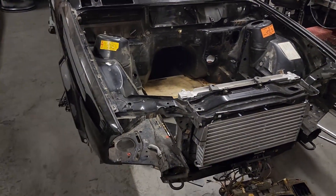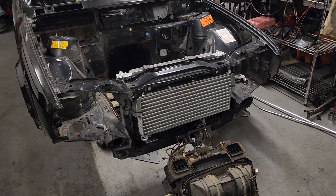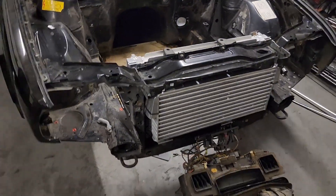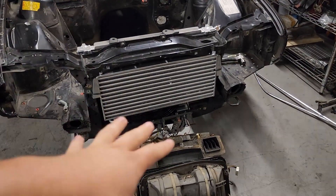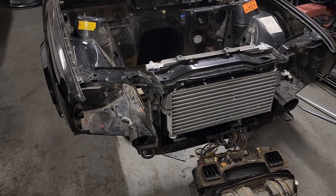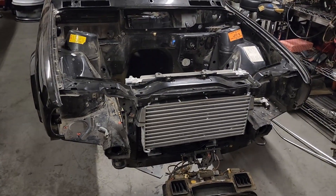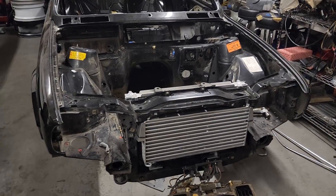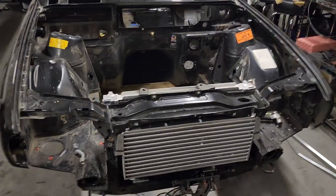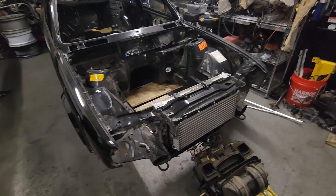As you can see, I do have an intercooler mocked up there. We will be doing an M20 turbo build with AC. I'm checking for clearances, trying to do the least amount of cutting. I want the intercooler mounted higher rather than lower like everyone else does. You can see the piping coming through the OEM brake ducts — everyone routes it up this way or cuts a hole — but I don't want to do that. I want everything to fit nicely so you still have AC, the right size intercooler, the right size piping. It's really hard finding the right manifold — I'm going to have to make a custom intercooler, but in the end it will be worth it.